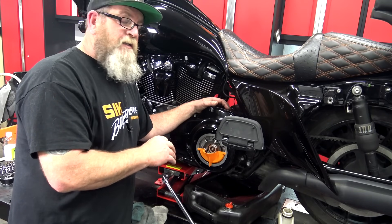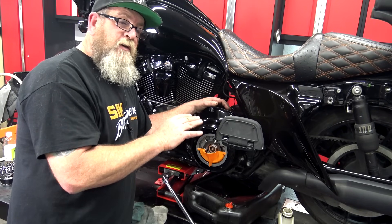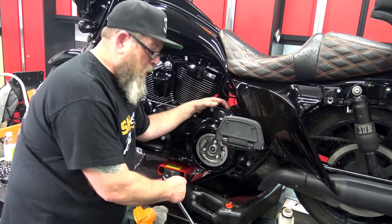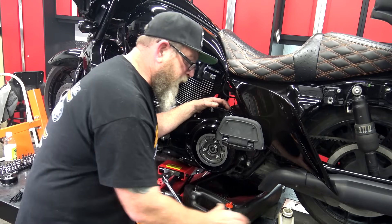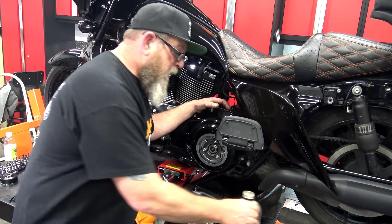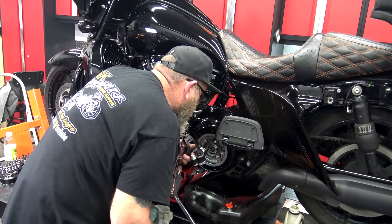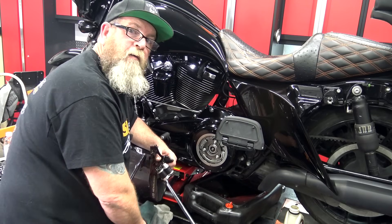Put your new clean plug back in — same torque spec, 14 to 21 foot-pounds. It even shows you a picture in the service manual of where the oil level is supposed to be. You've got a black and a silver area; you want to be right on the edge of that black, which gets you right up to the bottom of the pressure plate. If you're up into the silver you've got way too much fluid. Using the graduated cylinder, this bottle is 32 ounces — pour out two ounces to leave 30. Start with about 28-29 ounces and keep inspecting until you're just at the bottom of the pressure plate. It ended up taking the full 30 ounces that the service manual calls for on a wet fill.